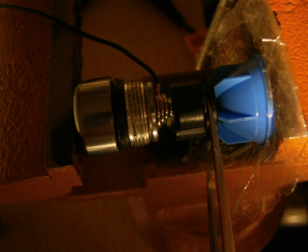I thought it would be nice to see the contacts in action while they are doing the on-off cycling. Since you cannot see what's going on inside the flashlight, I took the inside out and prepared a bare bones flashlight that consisted only of the reflector, the light bulb, the switch cylinder and the tail cap with the spring. As a replacement for the aluminum hull contact, I didn't have anything suitable made of aluminum, so I took a new scissors blade made of stainless steel.